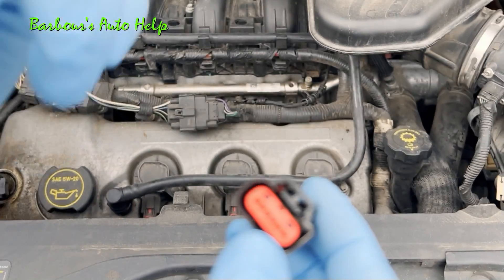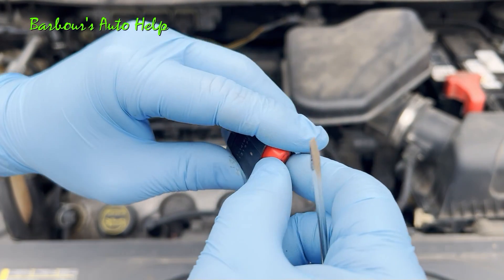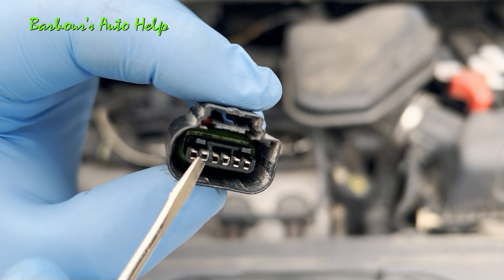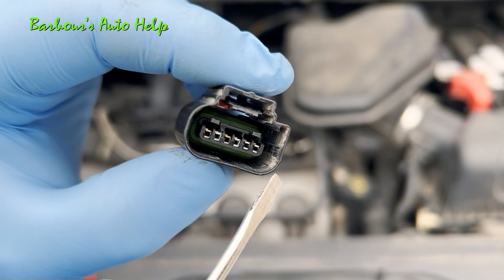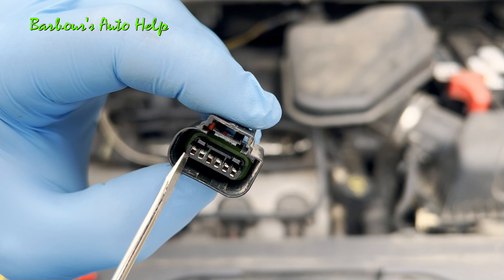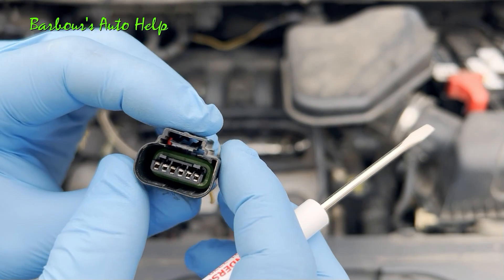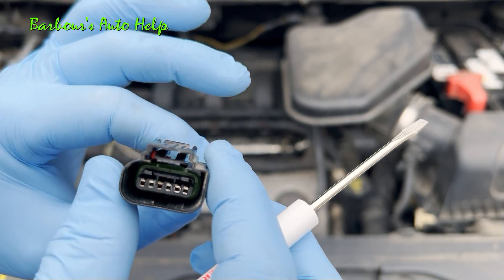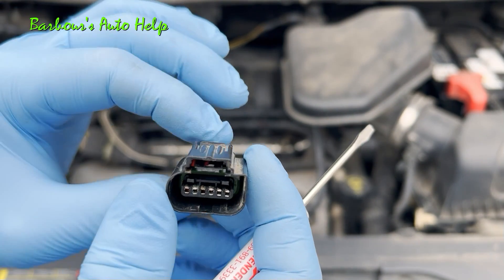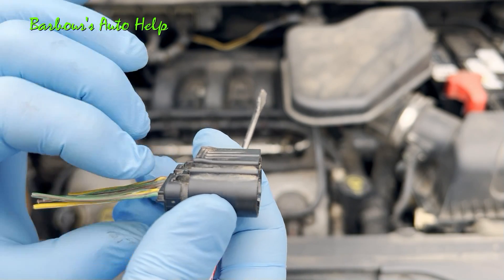That's not the only thing you want to check — let's go deeper. We're going to remove this lock; this is the pin lock, it keeps the pins from scooching out. You can see on this pin right here in particular there's a little bit of green corrosion inside there. This is a connector off of a throttle body. You want to check for corrosion and make sure you've got nice clean pins. Also make sure that none of the pins are pushed out — they should all be pushed forward, and that goes for the male side too. You can give these a little tug on the back, making sure the pins are fitted in all the way and that the crimp on the wires is secure as well. Just a little tug — those pins should not come out.